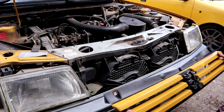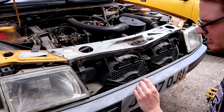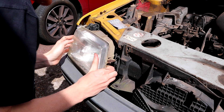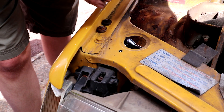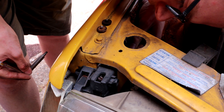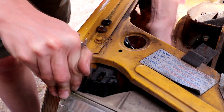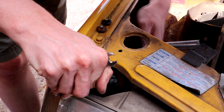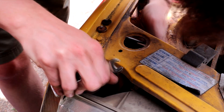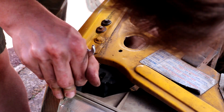With the grille out — assuming you don't snap your bolts — we now have access to the headlights. The lights are held in by pieces of wire that just hook over. The headlight adjuster, which has the headlight and indicator attached to it, has a 10mm nut on one side. I'm holding that with a spanner and cranking against it with a ratchet, but the bolt head is very rounded and I've had to basically hammer a hex-headed piece into it.